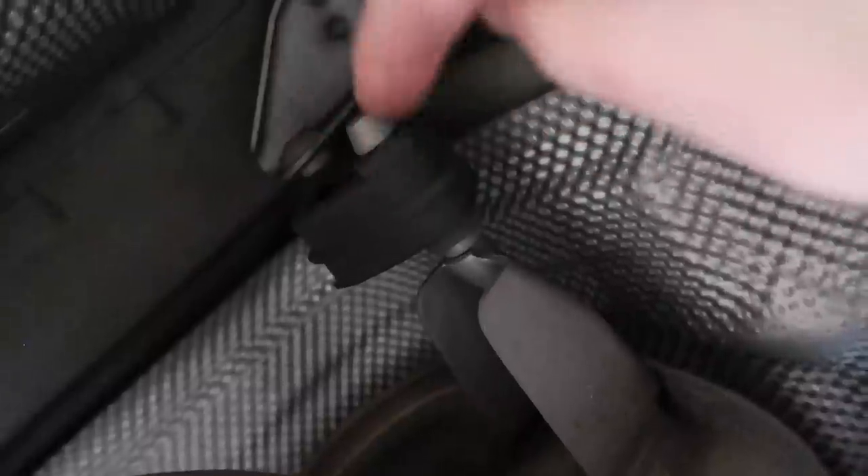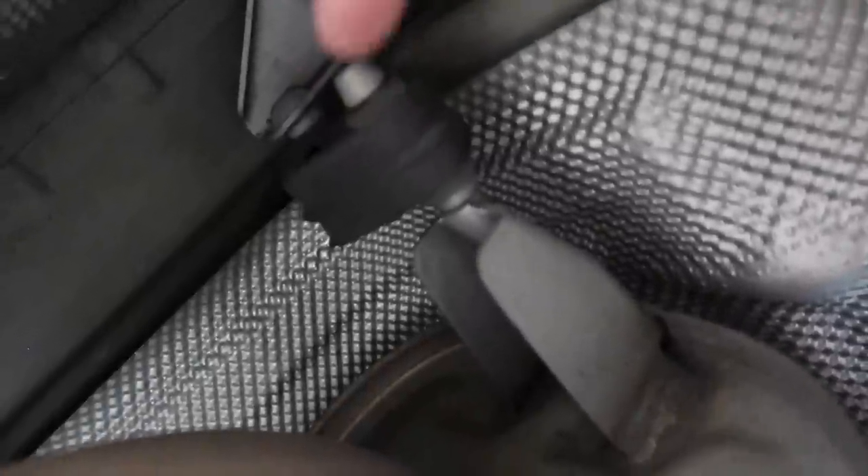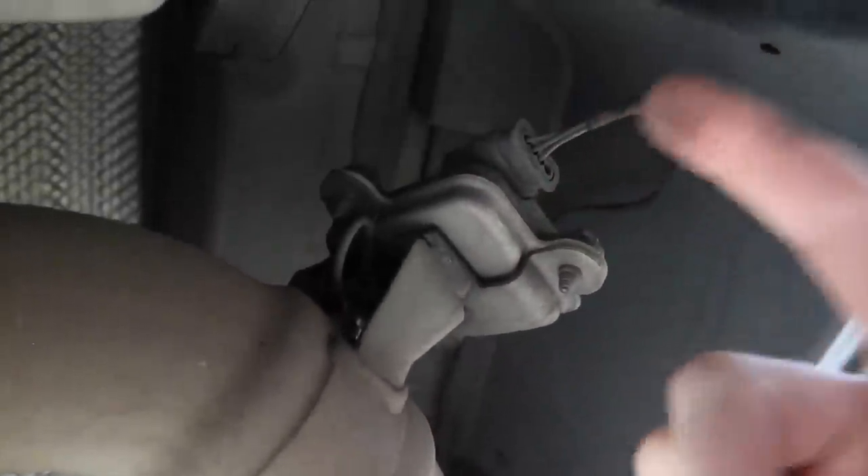Most cars use a rubber grommet, but in this car you've got to move the bolt on both sides and then you can take the muffler off when it's off the car, which is so much easier. Shout out to BMW for figuring their stuff out. Let's go ahead and take out those two bolts. We also gotta unplug this sensor real quick — this sensor is what I was talking about with the valve, it's the original valve. It even comes with the extended connector.